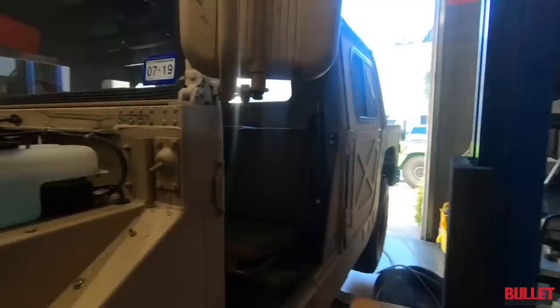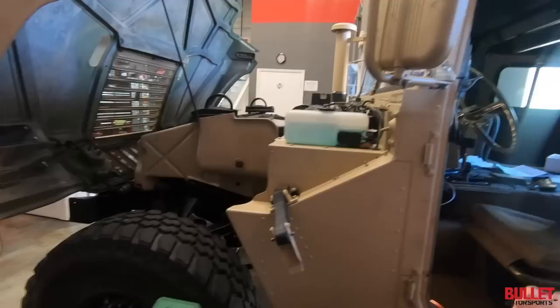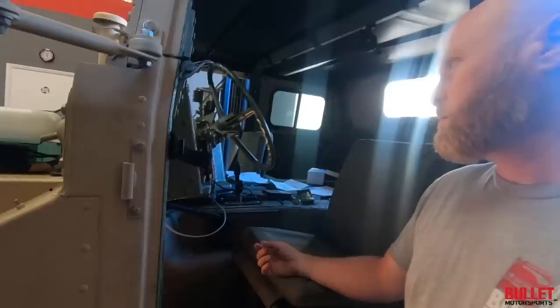It turns off on its own time, so yeah, that's a big problem. We don't want it to drain the battery for the ECM, right? And then we also couldn't use the original one that reads the RPM, the one we're taking out of the TAC. We couldn't use the original hardware for the TAC, so we ran another box from Dakota Digital.